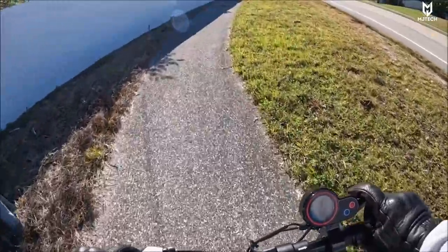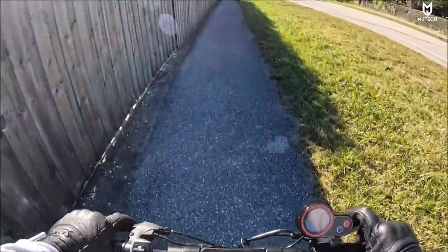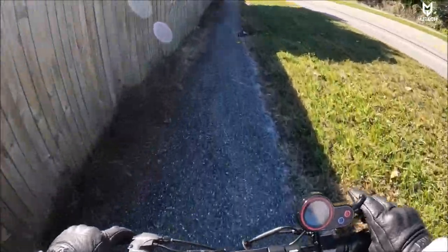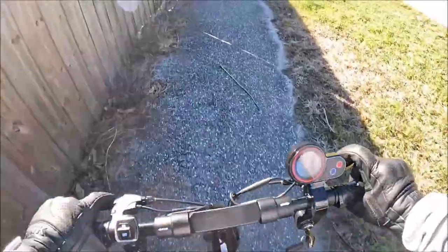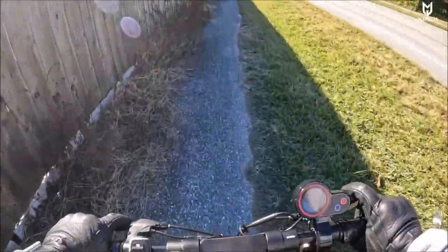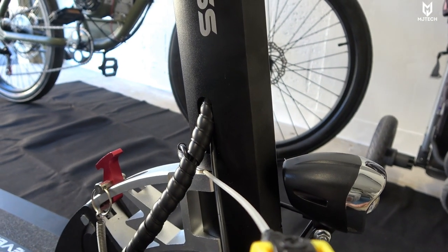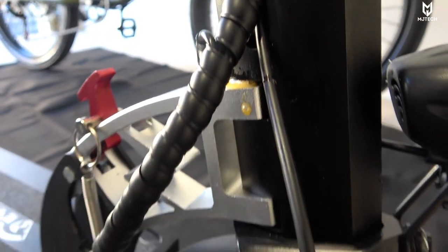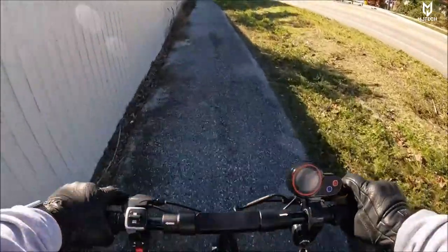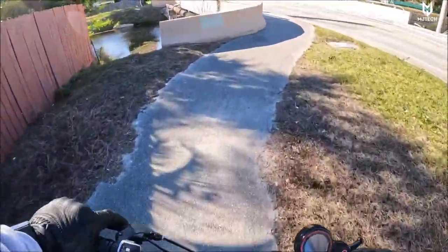The Evercross is all set up and ready to go. I'm not a fan of the seat personally — it's just a matter of preference — but I gotta say this thing rides great. A lot of people have complained that it sometimes feels a little unstable; the issue is where the suspension connects to the frame there's a bolt that needs to be greased or oiled. I added oil and now the steering is really nice and smooth — I'm not getting any speed wobbles. Currently doing about 17 miles an hour and it feels great.